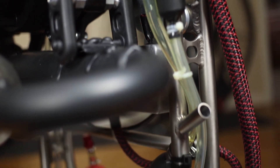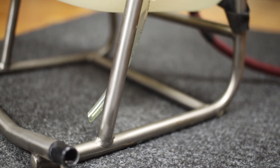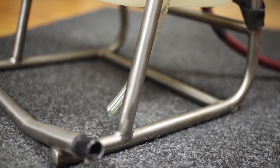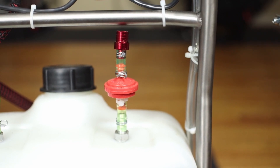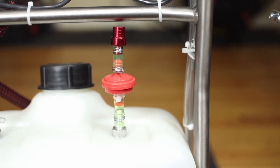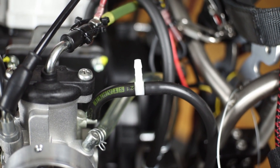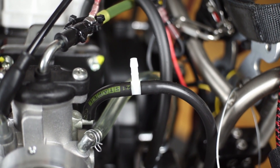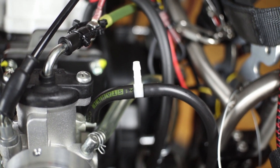Here's the classic Polini drain funnel — a funnel to channel various drains from the carburetor system, including the manual drain for the bowl for very easy main jet changes. We can follow that down through the feed system. You can actually route that to the gas tank, which I may go ahead and do. Let's take a look at the fuel filter on the gas tank vent. You always want to filter the vented air so as gasoline is used, you must have makeup air — otherwise the gas tank would collapse. On the Polini Thor 202 specifically, this factory vent hole at the top is where you'd put that one-way valve and filter, so I'll relocate that vent up top.